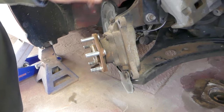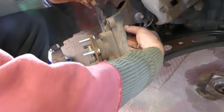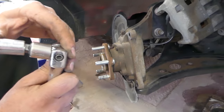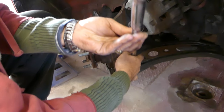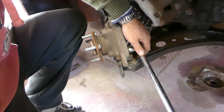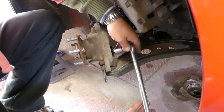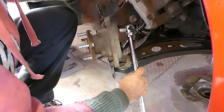Let's see what the bearing looks like if it's visible. On the back we have four bolts that we need to remove — it'll be a 14-millimeter socket. We're really excited to get it fixed because it's really annoying at highway speeds. Last time coming back from the race we had to drive about three hours home and it just got really noisy.